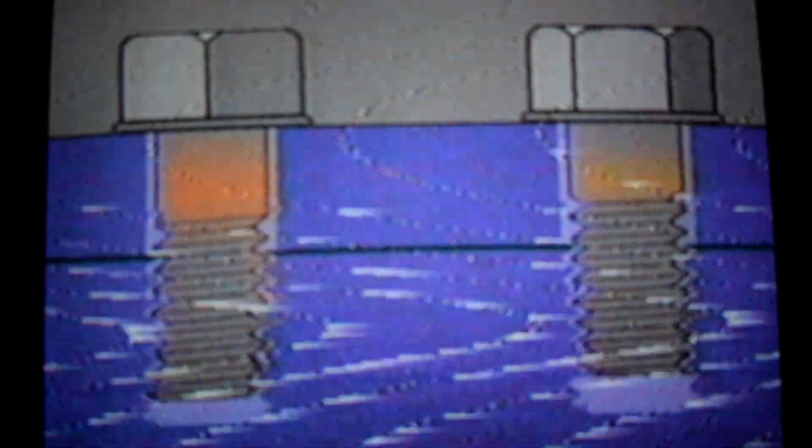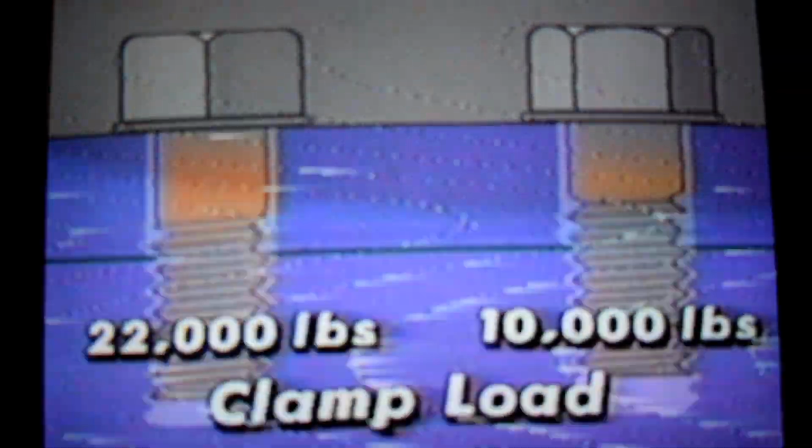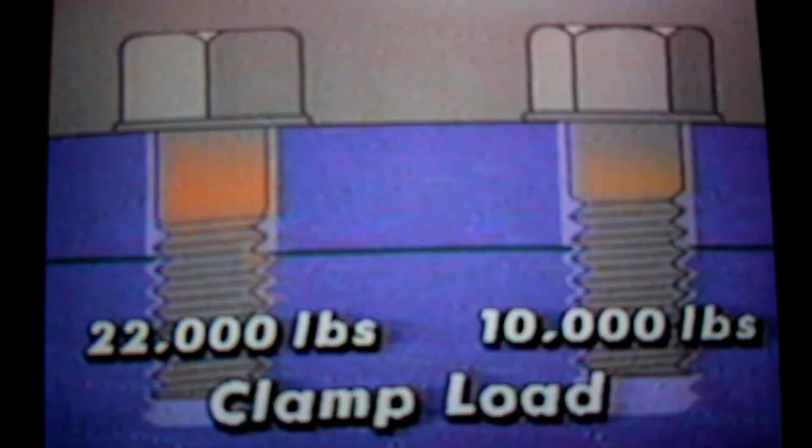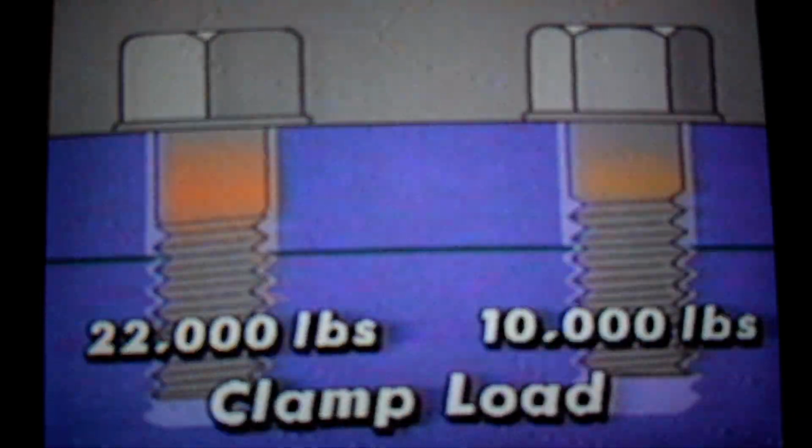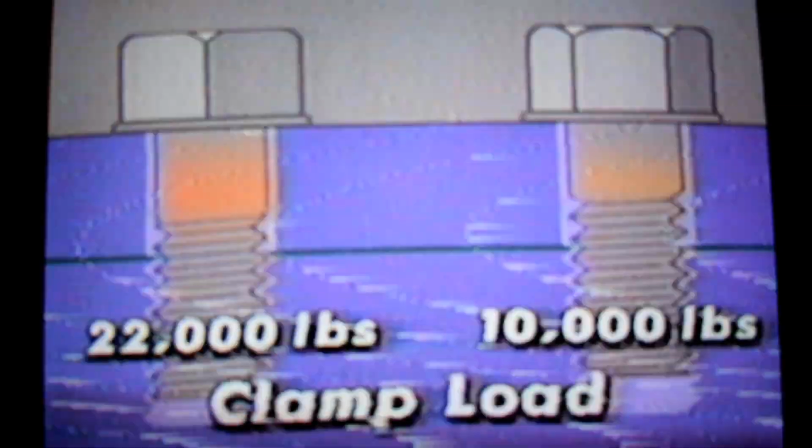What if these two bolts were tightened this way during an actual service operation? As you know, cylinder head bolts must be tightened in a specified sequence. The sequence is designed to ensure that clamp load produced by the bolts is spread evenly over the entire surface of the joint. This is done to prevent distortion of the cylinder bores and cylinder heads. Imagine the possible consequences if a clamp load variance of 6 tons was allowed between bolts. At best, the gaskets will leak. At worst, the engine could be severely damaged.